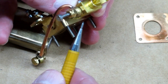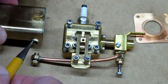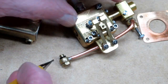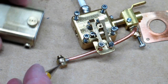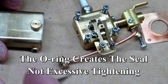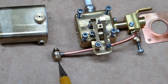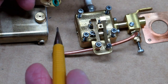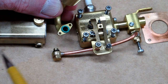You can unscrew the needle valve, loosen this nut up a little bit so this piece can move, then unscrew this from the tank. Inside here are some very small, delicate o-rings — you can see one trying to come out of there now. Keep track of those and don't overtighten them; you just need them tight enough not to suck in air or leak. You need to get all of the air out of the fuel line before this thing will run. The exhaust also has a small high-temperature o-ring on the exhaust pipe flange.